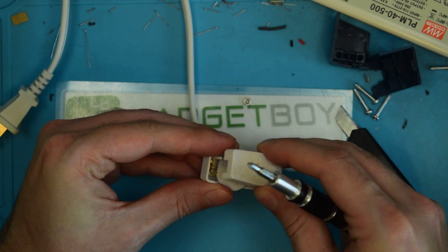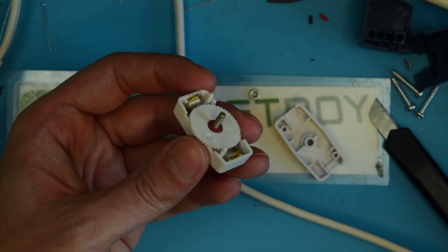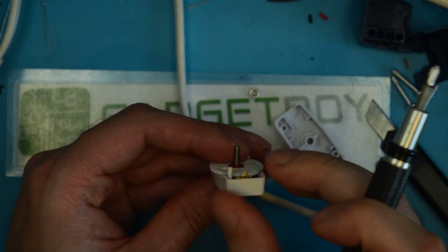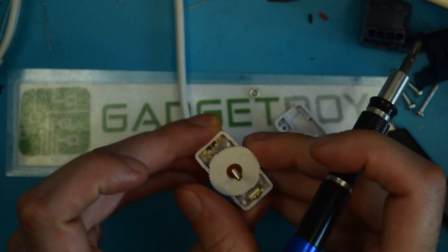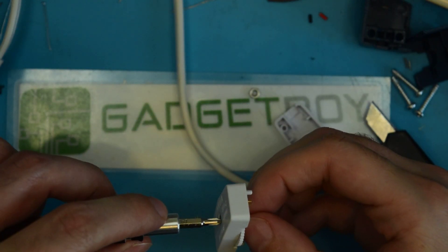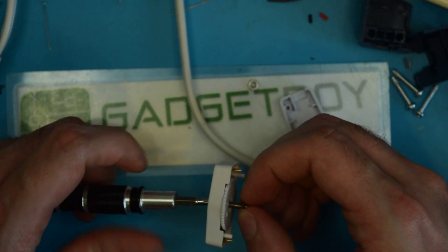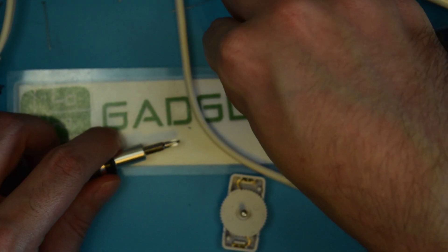So that little nut's going to fall off, and then we open up this side. If you look on this side, you'll see that we've got little pokey bits — those bite into the insulation and into the wire. We've got the same thing on this side, and then we've got the switch here. Now, there's a little fiber washer here holding everything together, so I'm going to go ahead and quickly unscrew the screw from that fiber washer, because if you try to pull the fiber washer off you're more than likely going to break it, and that would be unfortunate because it's needed in there to keep everything together. So that's the fiber washer off.